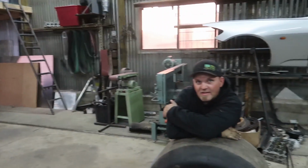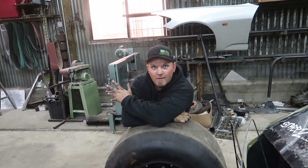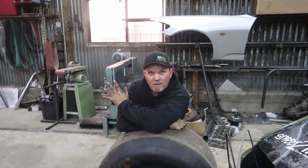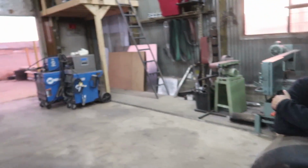I heard alternator, so I don't see a necessity for a mechanical pump if we're gonna have an alternator. True. Not a 16 volt. I'm just always about methanol and as much fuel pressure. But yeah, we could. A1000, especially since there's no way we're gonna get a built motor in here. We're not even trying to do that. So we're gonna be on the stock engine. I think the A1000 will do everything we want to do.